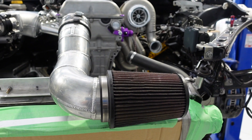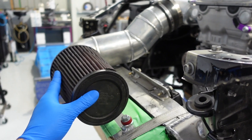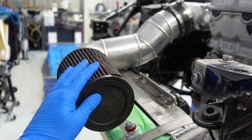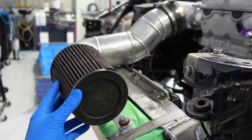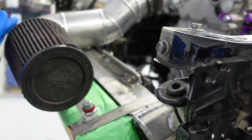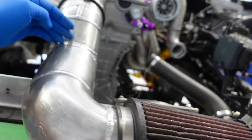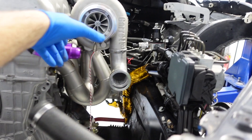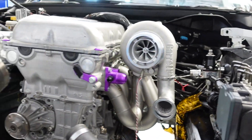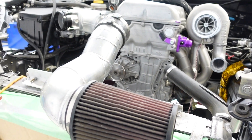We also need to sort the inlet for the turbo. On a really tight timeline, we're going to try and make use of the original inlet we had on the V8 — this saves us time, and it already packages well with how we're doing the intercooler and bumper. We'll slice through here and build an intake that comes up and feeds into the front of the turbo. That should end up quite tidy and save us time.